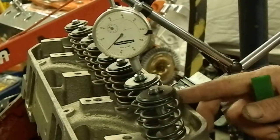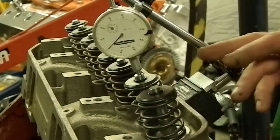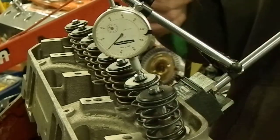When you articulate the intake valve through its travel, you can get a definitive answer of how much piston-to-valve clearance there is at top dead center. Most camshaft master catalogs will give a specification for how much valve movement happens when the camshaft and piston are at top dead center. Although a lot of variations change that piston-to-valve clearance, the actuation of the intake valve is always the same — the only things that would change that would be the valve lash and/or rocker arm ratio.